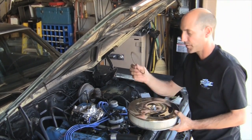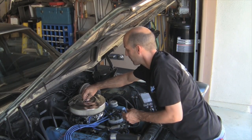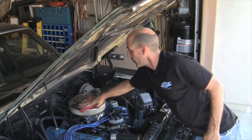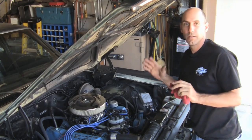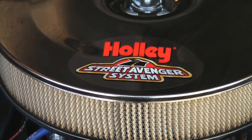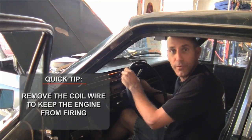Don't forget to put the gasket on. Put your air cleaner on and double check. Your carb is now installed. We're about to fire this thing up and check it with the factory settings and see how close it is tune-wise. While I was working around the top of the engine, I couldn't help but clean up and organize the plug wires and made sure to slap my sweet new sticker on the air cleaner. So now it's time to crank it. I've double checked everything, everything seems tight. We'll check for fuel leaks — just crank it. Let the fuel pump fill the bowls with fuel.